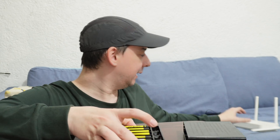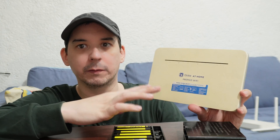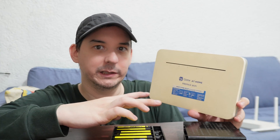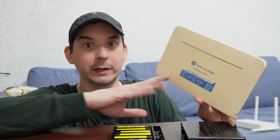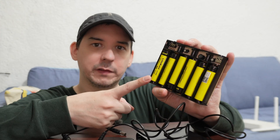The reality is that even if your modem or router says 12 volts at 1 amp — which is 12 watts — a lot of the time they actually sit somewhere between 3 and 4 watts, and they just fluctuate upward depending on usage. So even if it's rated at 12 volts 1 amp, chances are most of the time it consumes less power than that.